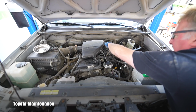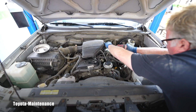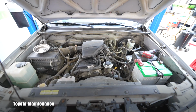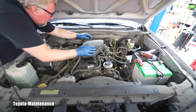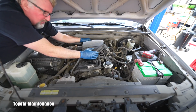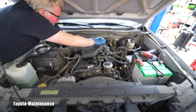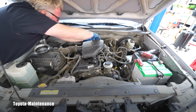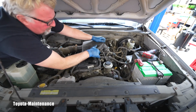So this will be the last 10 millimeter right here. I'm loosening those clamps so we can lift that whole part, and we will create the space for those spark plugs to be removed. There is one big hose on the back here, which is the crankcase ventilation. There are steel clamps on it, which you push on with the hand. I will show it to you when I pull it off.